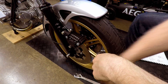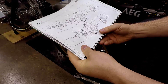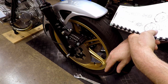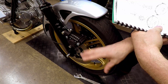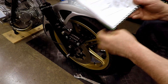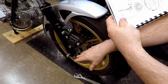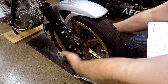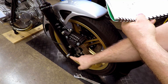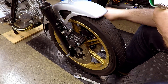What I'm going to look at now is how to tighten the front axle on this bike. Before I looked at this I wasn't entirely clear on how it works, but after a word with Brooke it all became very clear. I couldn't find the information I needed online. Unlike the rear axle, the fork is not squeezed onto the axle by two bolts - there's no bolt on one side, just this pinch bolt here which squeezes the fork on this side, and then a bolt on the other side.